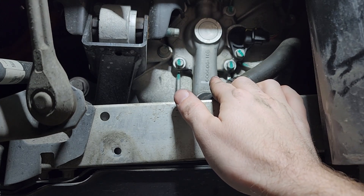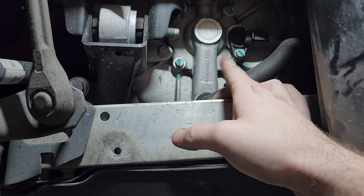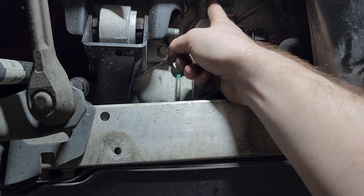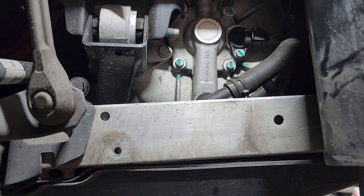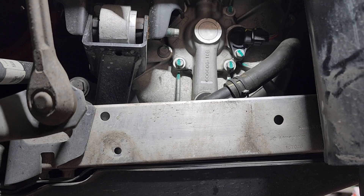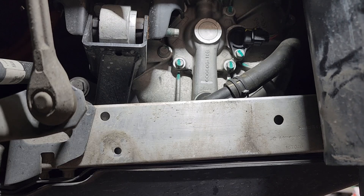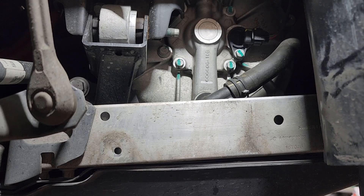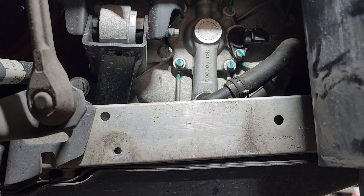I use the QC Charge manifolds, though there are other options out there too. I've seen some versions that eliminate the flyover tube — I'm not a big fan of that because it creates air pockets in the cooling system and potentially leads to reduced cooling for the gearbox oil. But anyway, that's pretty much it for the issues. I'll go ahead and get started on the rebuild for this thing and we'll get it back on the road.